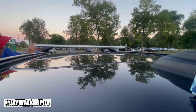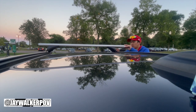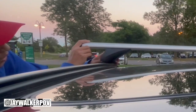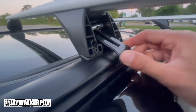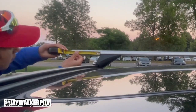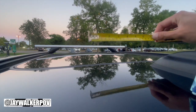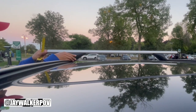Taking one of your aluminum rails, place it over the top of your car's raised side rails towards the front of the vehicle, with the hooks on the boots loosely clinging to the outside groove of the raised rails. When I measured the distance between the end of the aluminum rail, including the end cap, and the outer edge of the boot for my Mini Cooper S, it measured just over 7 inches, or approximately 18 centimeters, on each side. You can easily shift the rail to adjust the proper distance.